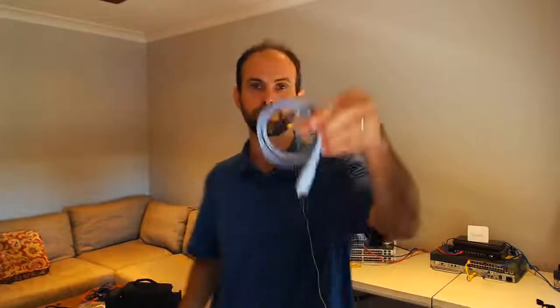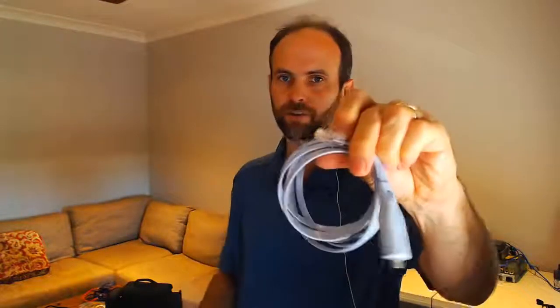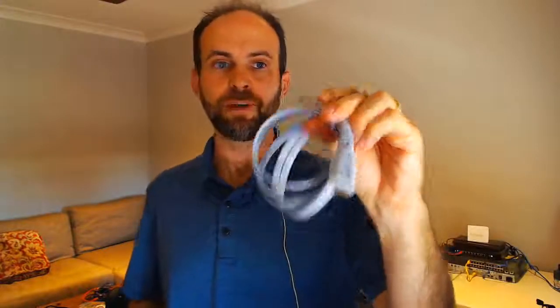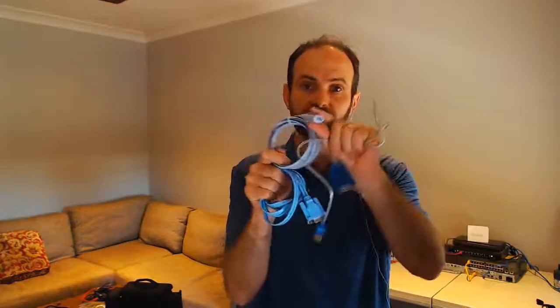That's the way it uses and identifies serial interfaces that it uses for communication. Now, you could also save an adapter by just going with one of these. This is a USB-C to RJ45 rollover cable. That's the type. Console connection. If you go with one of these, all you save is your junction. Again, Windows sees this thing as a COM port using the correct driver software, so pick your poison, right?